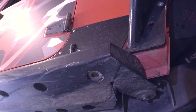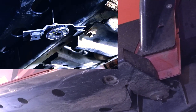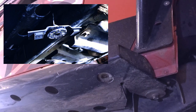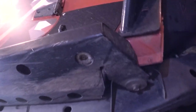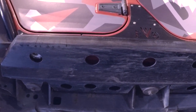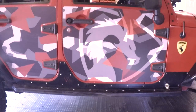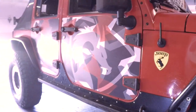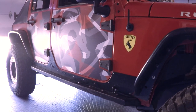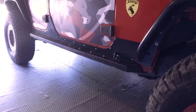The next Cyclones are mounted inside my sliders. Basically they have a horseshoe mount over top of them with a couple of magnets holding them down onto the rock sliders. I've had these for almost a year and a half and never damaged them. I have one in the front and one in the rear — they provide really good general illumination under my Jeep along the sides. I also have these tied into the interior light circuit, so they act as courtesy or puddle lights when I unlock the Jeep, giving nice lighting in a parking lot but also a good light array off to the sides when off-roading.